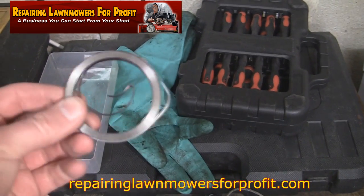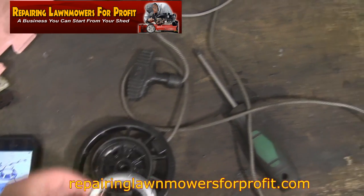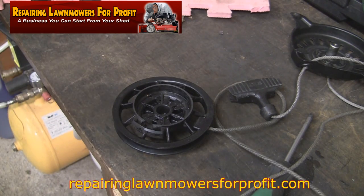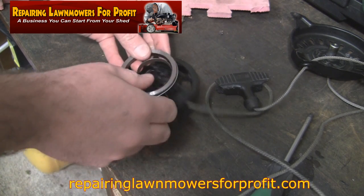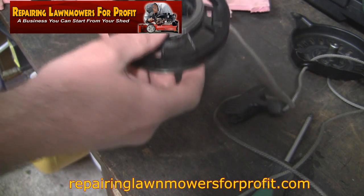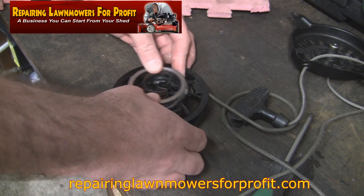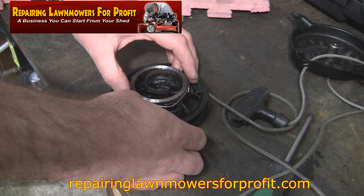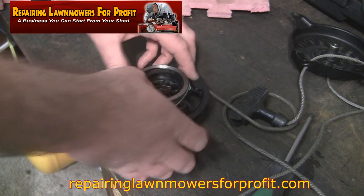So for three quid, or whatever it was — two pound fifty — it's really not worth the hassle. My next job, once I've got some safety glasses, is just to try and push this in here in what I think is the correct order for this recoil. Now I've got my glasses on, my challenge is to somehow fit this in the correct way — which I'm hoping is anti-clockwise with this little notch catching in there. To me it still looks like it's wider than this actual housing, but I think it just wants pushing through. The only thing I can think to do is put it on exactly where I'm going to need it, start pushing this through, get it lined up as much as I can, and hopefully inch it through.